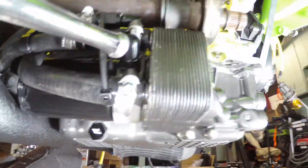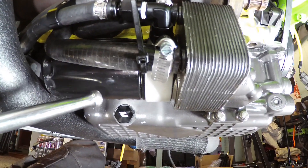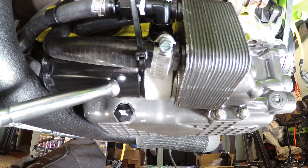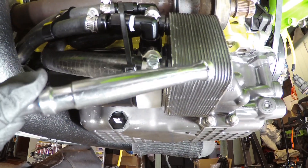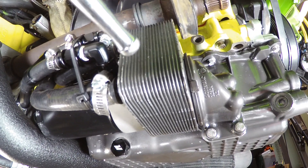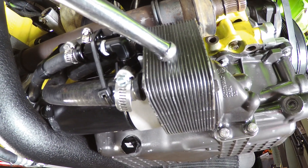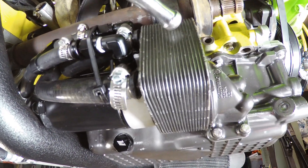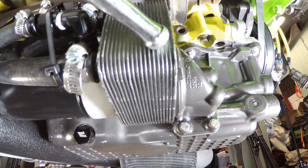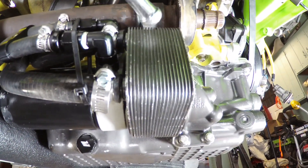What's going on right here — this is your oil filter mount. Here's my oil filter. This is the factory turbo oil filter mount, and this finned part of it is actually a cooler to cool the oil. That's factory. So it needs to have antifreeze coolant flowing in and out to cool it.